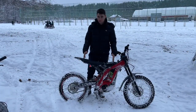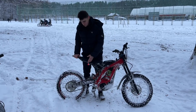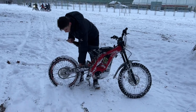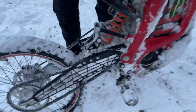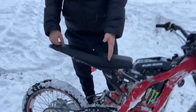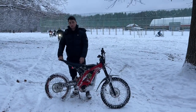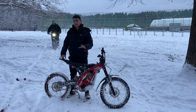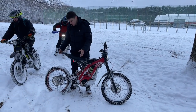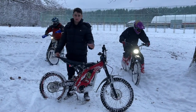Alright, the test drive is finished. We will take into account the community's feedback and improve our swing arm before the final release. To summarize, the custom swing arm does give you great stability at speed and works awesome for riders above 180cm in height. However, low speed maneuverability is slightly worse on this bike. All in all, we absolutely satisfied our local riders with this modification and will shorten the lower reinforcement plate of the swing arm to possibly fit a wider tire.